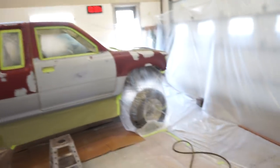Hey, what's up everybody — back on the Toyota build painting this thing. Check out the last video; we've got this thing all ready to go. Got the entire truck masked off ready to spray. So now all I really got to do is wax and grease remover and tack it, and then we're gonna spray the sealer on, and then we are spraying color and clear. So let's get to tacking and cleaning this thing up — get it ready to spray.